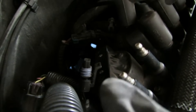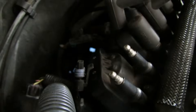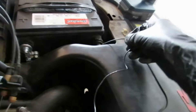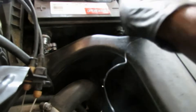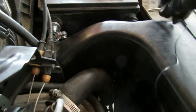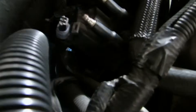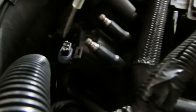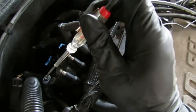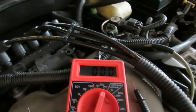The fourth thing you want to check is whether power is going to your ignition control module. Disconnect the ignition supply and use a 12-volt test light grounded to the battery. Put the key in the car so it's just in the on position, and when you touch the connector, if you're getting power the light will come on. That's the fourth step.